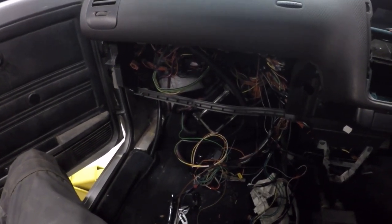Figured out the TPS problem — I should have used the CAN signals rather than trying to use the analog 5-volt input. On this engine, the TPS uses two different sensors for throttle position, cross-references them, and takes an average value across the two — that's why it wasn't working when I was importing just one of the signals. The CAN is connected now and it's all working perfectly, reading the TPS through the CAN network.